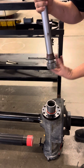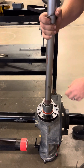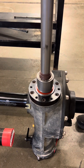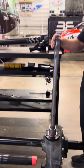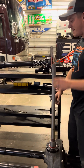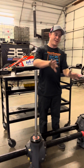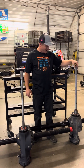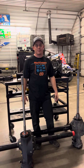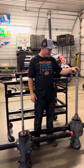This is a seal — we'll pack this full of grease, put this in there so it's all nice and lubricated. Push this seal in, snap that snap ring in there. It all stays nice and greased all the time and it moves, to help keep some of the bind out of the drive shaft. There's a lot of torque, especially on a wing sprint car — you have that wing pushing down. Without this, the coupler gets really hot and you have to replace the parts a lot quicker. This kind of helps the car float through the corner a little better with a wing.